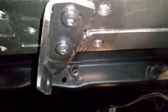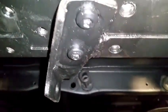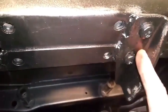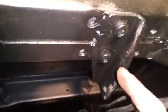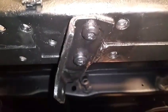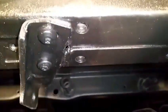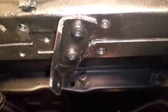While I was under here I've also done the prop bash bar hangers. A stroke of luck — when I cut these off the old chassis rail and drilled out the plug welds, I had holes in each one. When I lined them up in exactly the right place, they lined up with the holes for the old two-wheel drive gearbox mount. So I used low profile high tensile bolts, bolted them up and tack welded them along the edges. This one here was slightly out of line so I had to drill it and put a nut behind there. They're bolted and welded — I'm happy with that, they're not going anywhere.